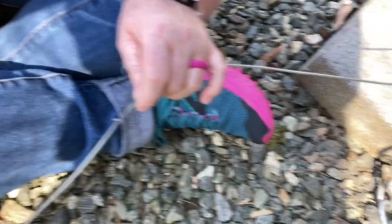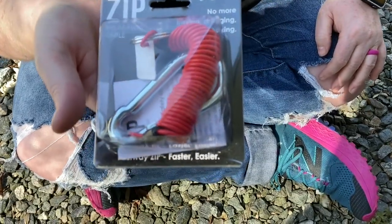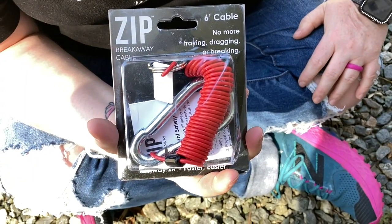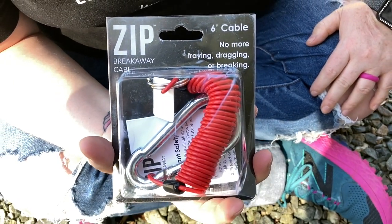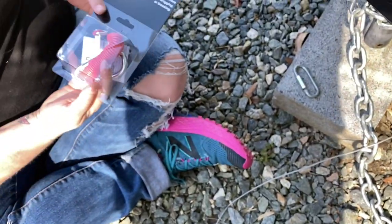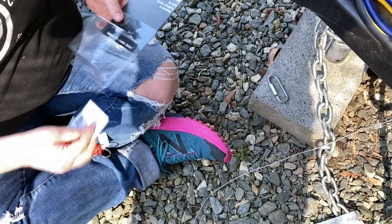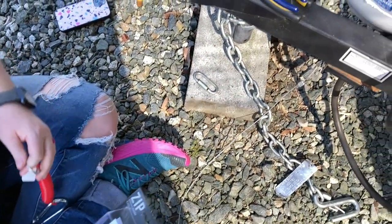What we're going to do to remedy this problem is we're going to cut this cable off. We're not going to replace it with another straight cable like this. We actually purchased one of these off of Amazon — it's made for trailer breakaway systems. It's a zip breakaway cable, a six-foot cable. What it does is we're going to cut this off and attach it to the pin itself, the little hole in the pin. And instead of wrapping it around the chain a few times like we normally do, it'll go directly to the attachment on the back of the truck. So we're going to replace this real fast.